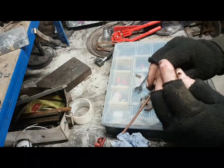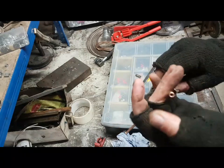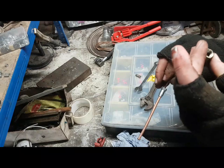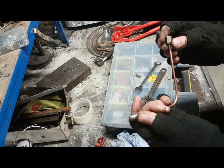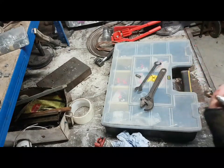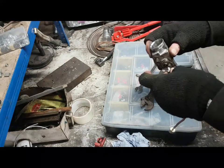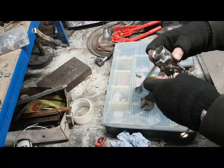And there you see, all it's really done is it's bedded that flare in. You don't have to do that, by the way, before fitting these pipes. It's just demonstrating how that male fitting fits on there. As far as the female fitting is concerned, it goes exactly the same way over the top of that. If you screw that into a caliper, in fact, I've got a caliper, one second. Here, this is an Imperial Land Rover fitting here. I'll wind him in here. And in he goes.